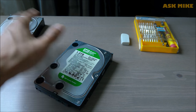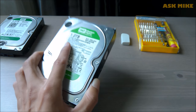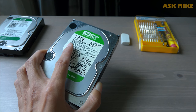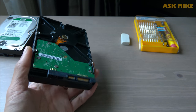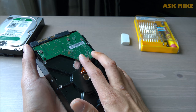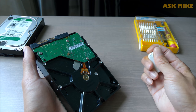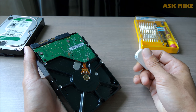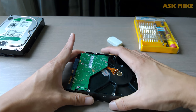Let's try with this one first. This one is the one that is without any activity, meaning when you plug in the hard drive, you don't get any response from the disc. You do feel that the disc gets started but nothing — you don't feel the disc spinning, nothing is happening. So what we would do now is take out this controller board and try to clean it up with an eraser on the connector head to see whether we can make this disc detected and readable again.